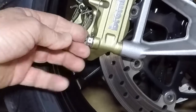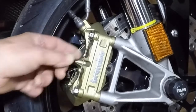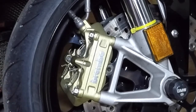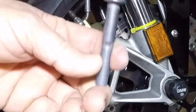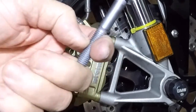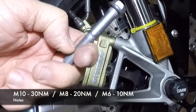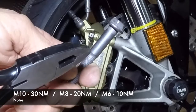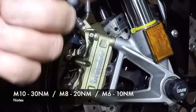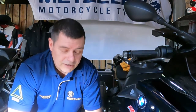So that it's not going to catch on things, I just poke it into the center of the bolt itself and it's out of the way. Now we've got a nice twisty wire holding the caliper bolts — pretty easy. The other thing to keep in mind is that when you put these bolts in they need to be tensioned correctly. An easy way to remember — Tristan from Pro Bolt gave me this tip — for M6 bolts torque to about 10 Newton meters, M8 bolts to about 20 Newton meters, and M10 bolts to about 30 Newton meters. As a general rule that's a pretty good way to go; it won't over-tighten the bolts. That's how you wire on caliper bolts.